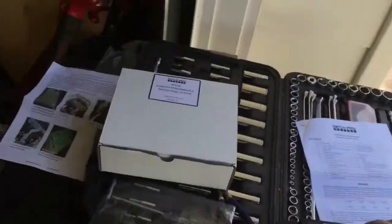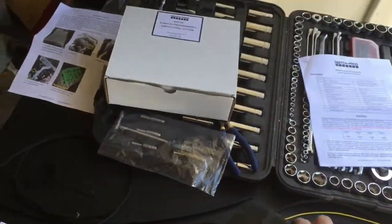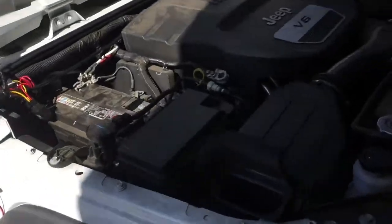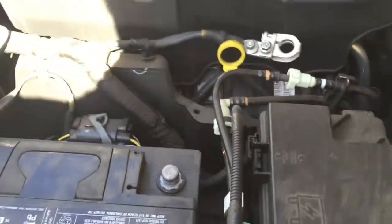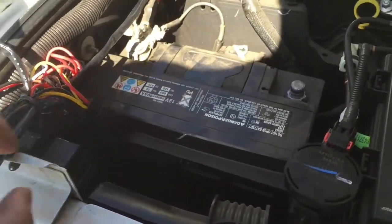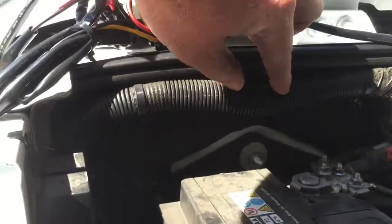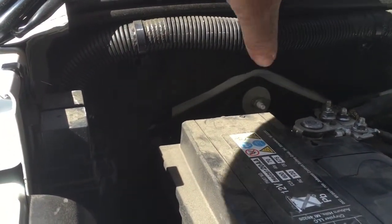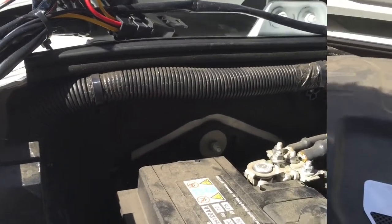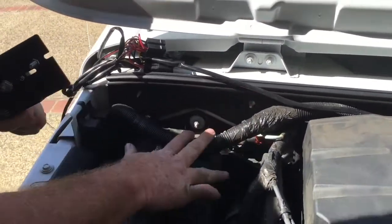What we just started doing: steps one and two are done — I mounted this to the plate and I'm getting ready to install it under the hood. I've gone ahead and disconnected the negative on the battery and tucked it up out of the way. I unhooked the wires we had already, so that's out of the way. The next step is to undo the wiring off of these two studs so we can mount that plate up under the battery and reinstall this back over the top of it. You just pull the harness off with these plastic tabs on the back, revealing the two studs.